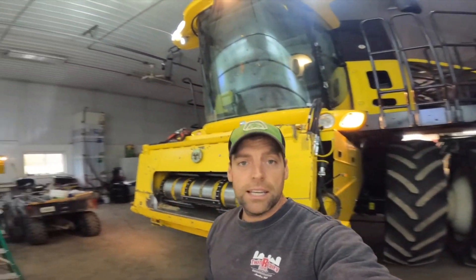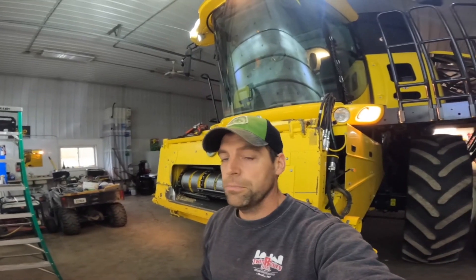Unfortunately today it's rainy and cloudy so I won't be out combining and can't give you a real-world nighttime experience of how these actually perform. Anything over the factory halogen should be better. As far as longevity, without the fan they should last longer — that's just my opinion. On Amazon there are tons of 9005 HB3 headlights, so use caution when buying: some are shaped like the factory and may fit better, some are like these and need a little modification. Hopefully this lasts quite a while — thanks for watching.